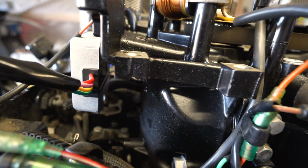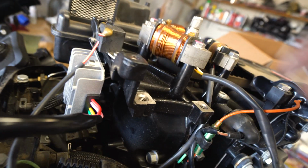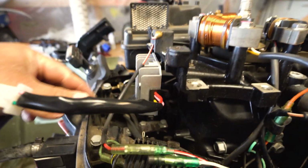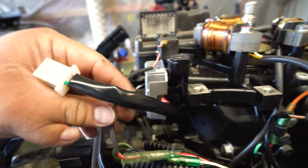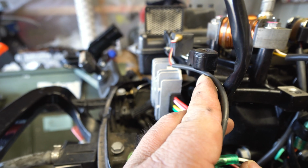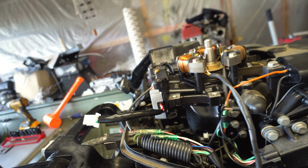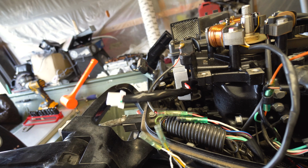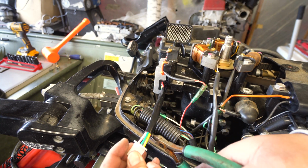We're gonna leave that right there. Shouldn't be a problem with the cowling. All the wires are kind of out of the way. This one's kind of in the way, but we will reroute that one. That's actually pretty important. This is the signal pickup line. So we might have to, you know, zip tie it off, kind of like that. Probably have to zip tie like that so it stays away from that, because it might get hot, right? But other than that, man, we're almost done. Just gonna splice these wires into this, and bam, almost home free. Okay, let's snip this.